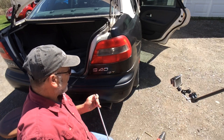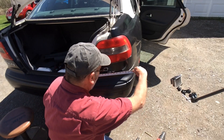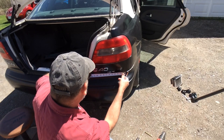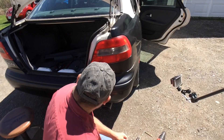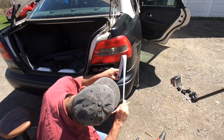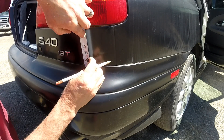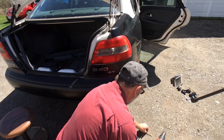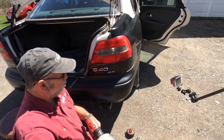The manual says to go about 11 to 15 inches apart. I'm going to come over about a foot and put the sensor right here — roughly mark about a foot, then come up from that seam about an inch and a half. I'll mark the spot right there, then take and drill a pilot hole first before I put the unibit in.